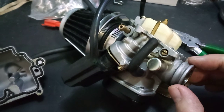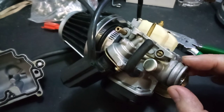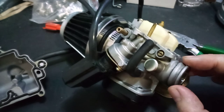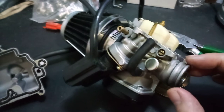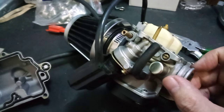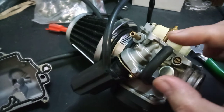For warming up an engine, 3100 RPM is kind of high. The problem comes when the clutch engages around 2500, so the scooter wanted to take off while it was warming up. I would have to literally stand there with my hands on the brake for two or three minutes until the engine warmed up, which was a big hassle. I think I have a solution.